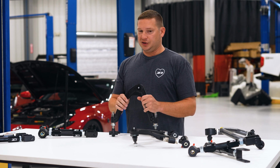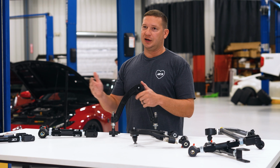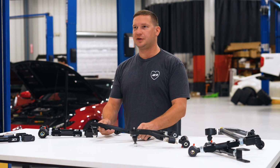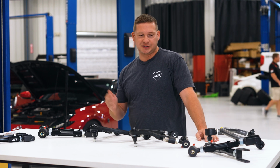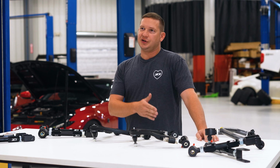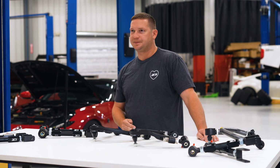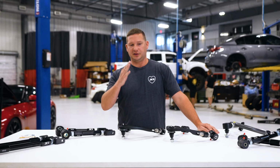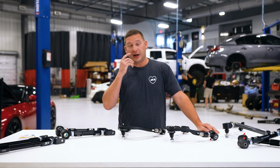That's plenty of range. On the range, if you're trying to go more positive, typically people would say they want to get closer to zero. They want their commuter Z that they have to make the front tires last. So they'll option for a set of the street arms if they're lowered a little bit. That lets you go a little further reach safely on the thread engagement, and it lets you have close to max of what you can fit in the fender for the adjustment range.